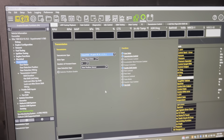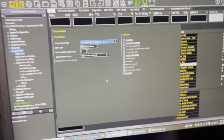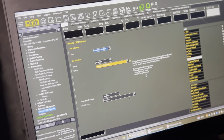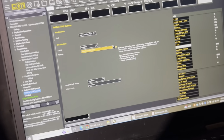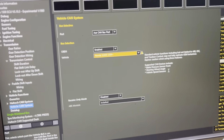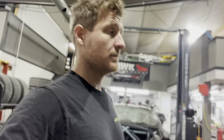This is an '06 S2000 — actually I think it's an '08, but '06 and up uses a different ABS module. We're actually feeding it all of the CAN info from the ABS system. We worked with Haltech on this — they really helped us out. We did some CAN sniffing on the ABS to basically get all the wheel speeds, the steering angle, and the brake pressure. We're pretty lucky there.